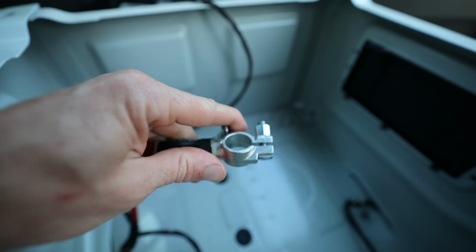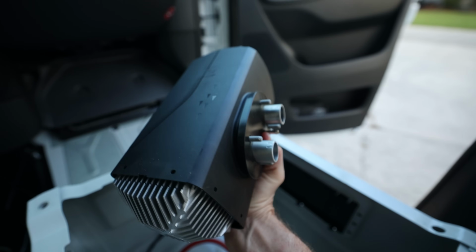You can see we have our driver's seat off right now. That's because this positive line to our auxiliary battery is routed underneath everything. I was going to try to take out the wire, but the way that it's connected, I have to take apart the entire electrical box here to get to it. So what I'm going to do instead is unhook both sides and tape it off with some electrical tape so it doesn't accidentally bridge any connections, and call that a day. Now we're ready to tidy up this area and mount the diesel heater.